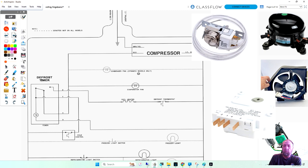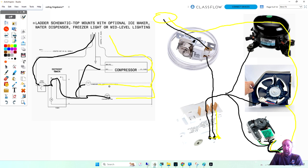The cut-in doesn't matter. As long as it's cold enough, it's going to close. When it cuts in, it's not going to start heating again because it's back in the cooling cycle instead of the defrost cycle, so it's not going to have an effect. You could carry that on your truck and use it on just about any refrigerator. It doesn't matter. It's a thermostat. So look at the limit of the one in the refrigerator, and you're within 2 or 3 degrees. It's not a big deal.